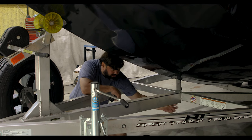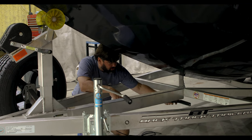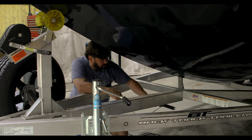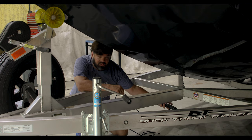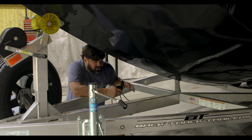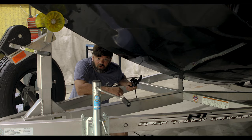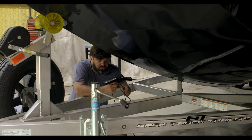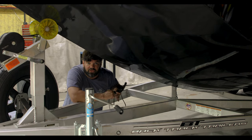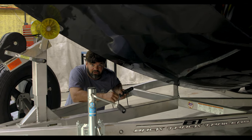We're going to take the self-drilling screws. If this beam is real thick you might prefer to pre-drill your holes a little bit so the self-drilling screw isn't struggling to get through thick material. We're going to mount this right here — it angles both lights out toward the tires and gives a great beam. This is a 23-foot bay boat, so it's a very large trailer and we're going to use the dual setup. It's a quick and easy two little holes, mount it, wire it in with the quick connects we provide, and you're done.